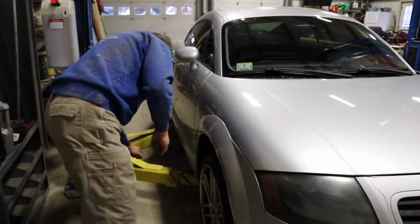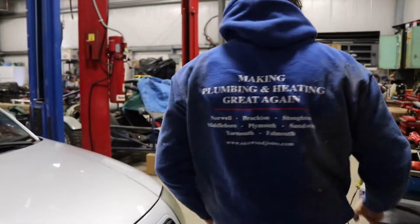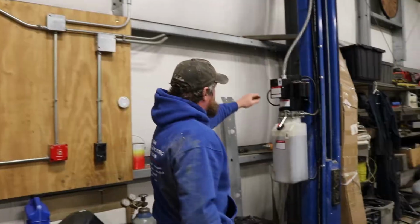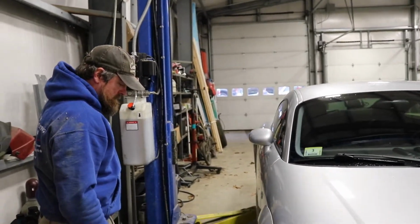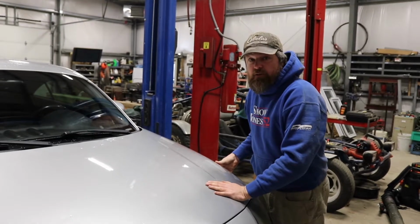Check your points again. Make sure that your beams are not touching the vehicle and only the pads. Get the vehicle all the way off the ground. And when it's just slightly off the ground, give it a little rock to make sure it's sturdy, because if it falls, you want it to only fall a little. And we're good.